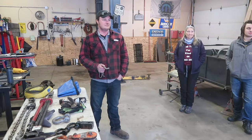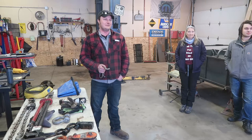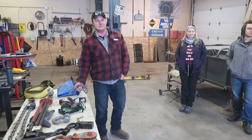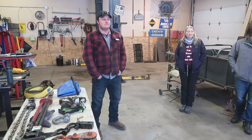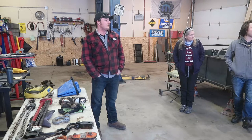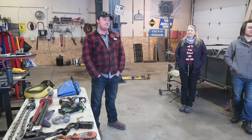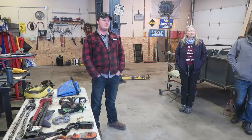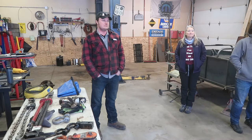I've actually had one rip out because it was misused beforehand. The kind you screw into, where you pop the plastic piece out and screw it in, are only welded a little bit on that frame. They're not solid. If you can grab an A-arm, like when the tow truck has to winch a vehicle up on the deck, the wheels are the stronger points of the vehicle. You can grab those and winch a vehicle out of the ditch, anything like that.